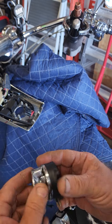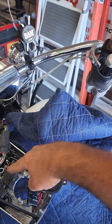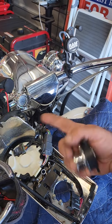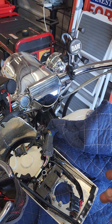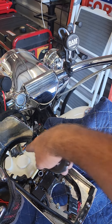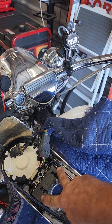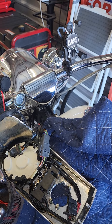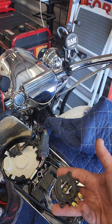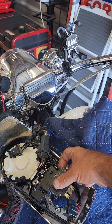So on the back of this lock, you go ahead and take the center nut off that's in the center. This is actually flipped upside down right now — you back that screw and this whole unit lifts off. You turn it over — here's the speedometer and all of that, here's your lights, and here's where the ignition switch goes. These four screws hold that switch down, and this is the plug that plugs in.